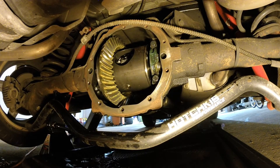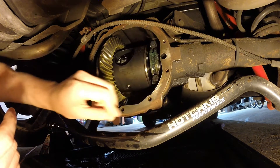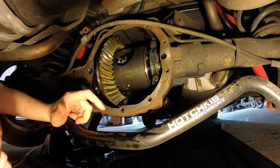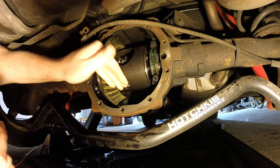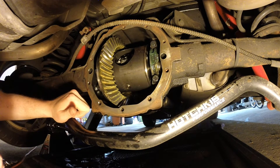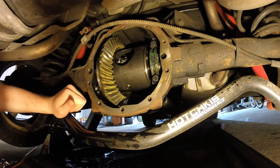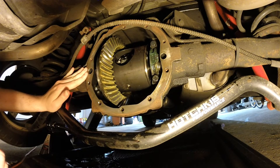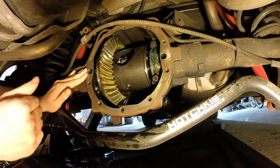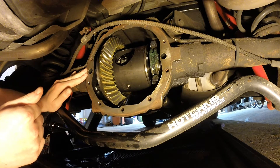Just like the magic of YouTube, the rear diff is clean. I'm sure if you're doing this at home, you've already cussed at it — it is a pain. One thing I do is take a rag and shove it inside there to absorb any leftover fluid, maybe get some extra gunk out, and also prevent fluid from pouring over onto my clean gasket surface. I scraped off all the old gasket and ran some sandpaper over it to get rid of the rust.